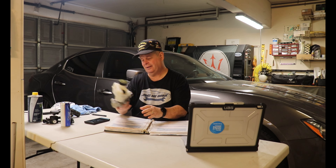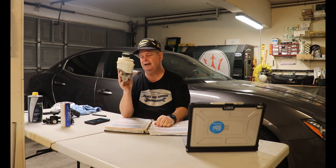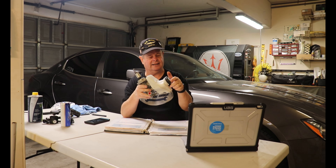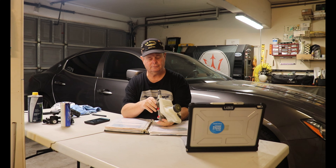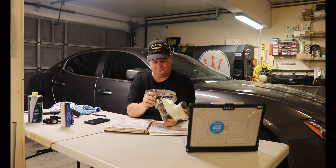The system has two tubes going to a T-junction, which feeds into the turbocharger. If those seals are bad, you get the same symptom. That's why I didn't just replace the air-oil separator — I replaced the entire oil vapor recirculation system. I don't like throwing parts at a problem; I'd rather fix it right the first time.